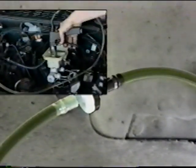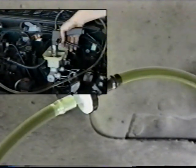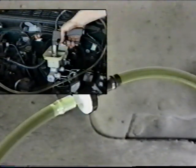Another reason why RFI has little or no chance of forcing contaminants back upstream is that RFI is only done after the system has been flushed. Flushing will remove the majority of the contaminants from the system.